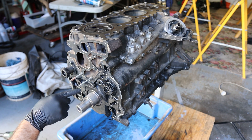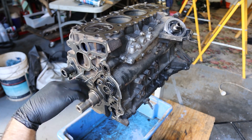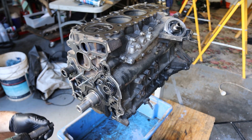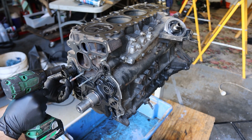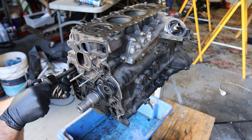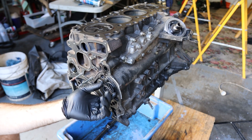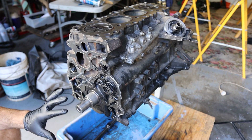At a glance, we can see all our oil galleries. This is where the oil pump lives and this is where the water pump lives — so that's where all the water gets cycled through the engine. And then in here are our timing gears and things of that nature. So we'll pull these balance shafts out. These are just here to balance the harmonics that come along with a four cylinder engine — that's why they're called balance shafts. They eliminate any resonant frequencies or damaging vibrations.